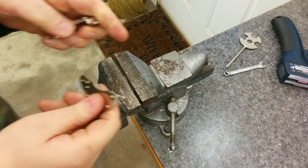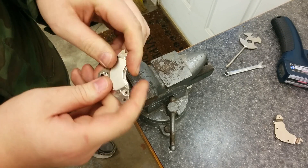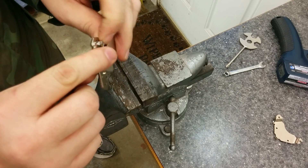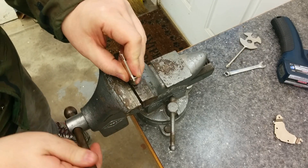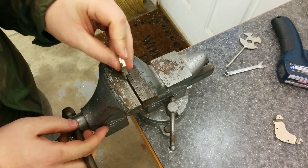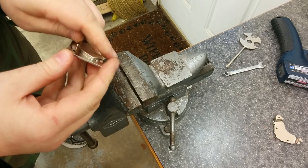To get these magnets off of these plates there are two general ways to remove glue: physical force — scraping, prying apart, or sometimes putting these into a vise and bending the plate away from the magnet. The other way is with heat. If you can heat up the glue enough it'll soften right up and the magnet will come right off without too much trouble.